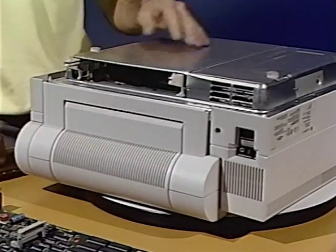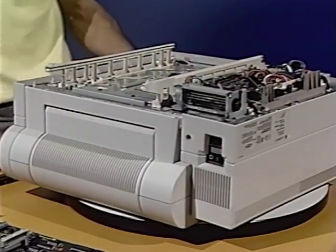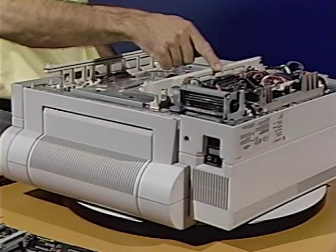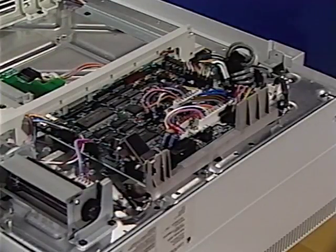The DC controller PCA is located above the IOPCA on the bottom of the printer. The DC controller PCA is the LaserWriter 2's command center. It controls and monitors the other three systems of the printer: power distribution, image formation, and pickup feed systems.